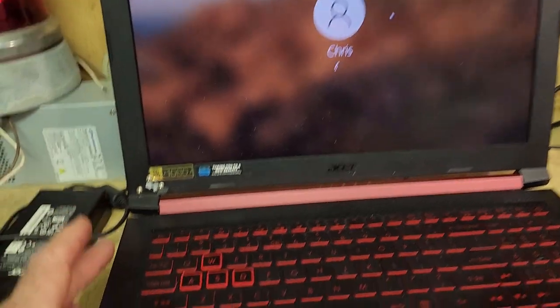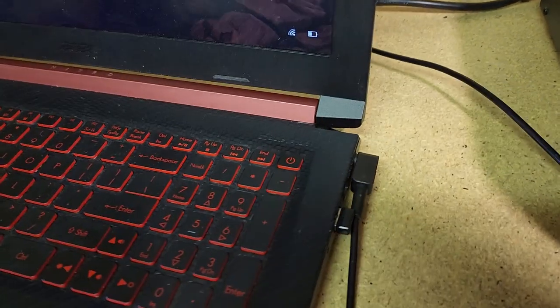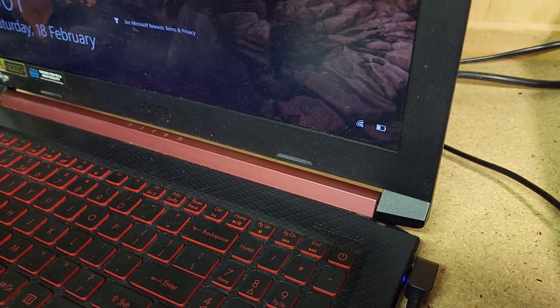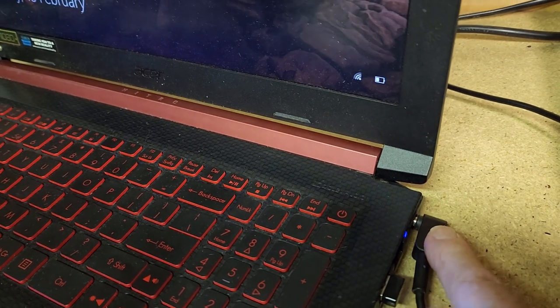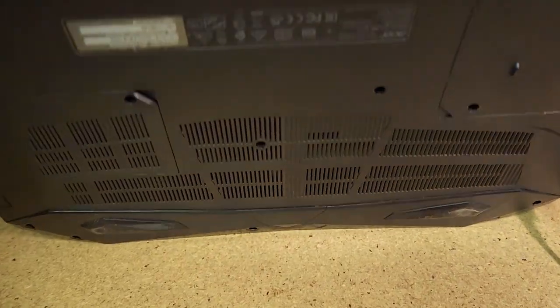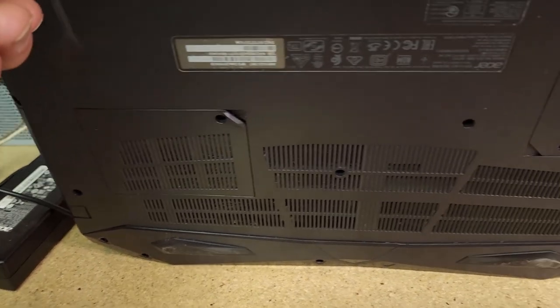The screen's good as you can see. It's had some home repairs. The hinge is actually broken and it flexes a bit. There's a crack through the case and a crack on the bottom case as well. Where the charger goes in, you can see it's flashing intermittently. The battery's good - I got it fully charged off Christine's charger and it lasted about two and a half, three hours. But the socket has pushed in and it's not connecting properly, and even when it does connect properly, this charger is intermittent.